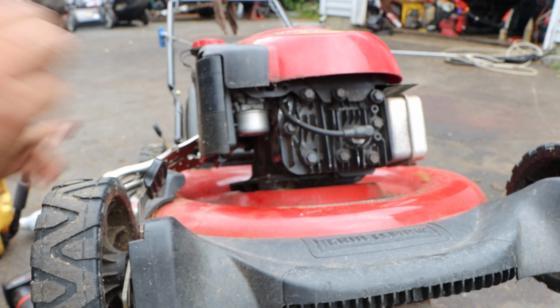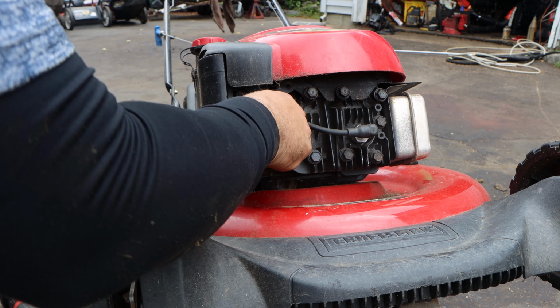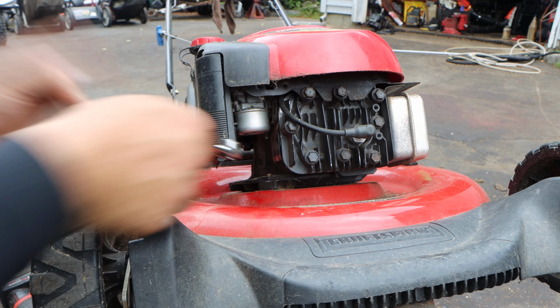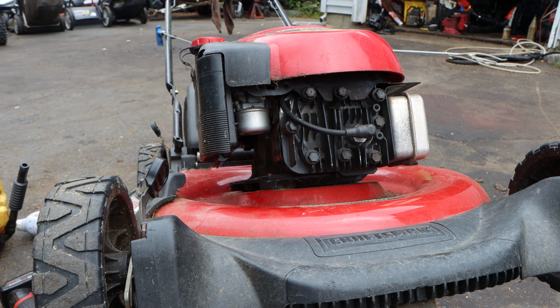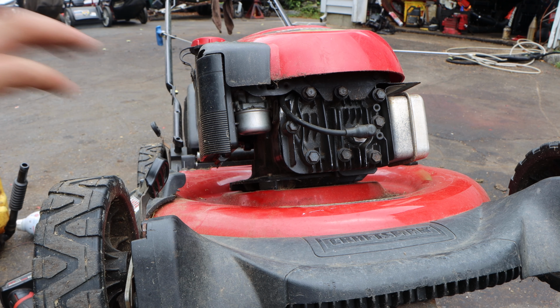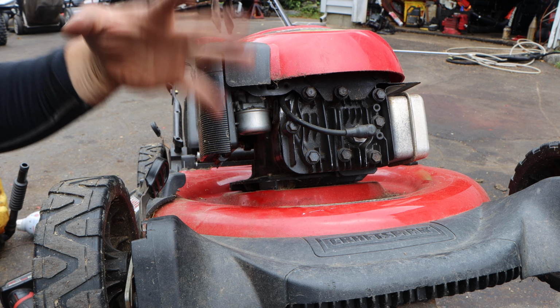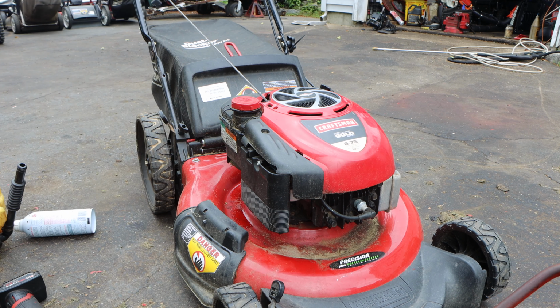Now, here's the crazy part. If I didn't go to sell that lawn boy, I would have missed out on this. Oh, and I forgot to mention it before, in case this is your first time watching the channel, okay? This machine running and dying after we injected go-go juice means that there's a fuel related issue. Once the go-go juice gets inside the cylinder, it burns and fires. Once it runs out, there's nothing to replace it, so it shuts down. So, fairly simple. Man.